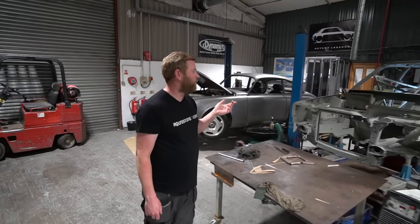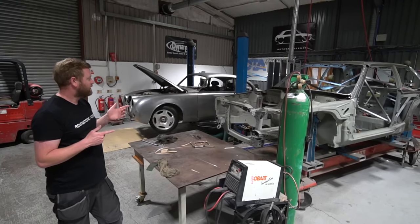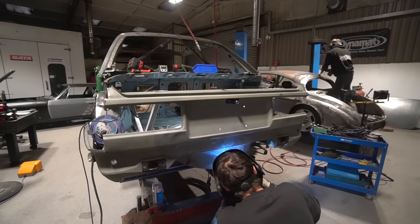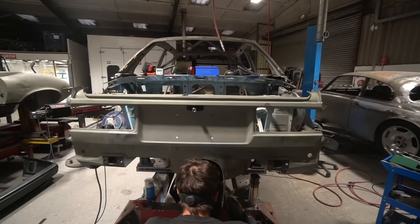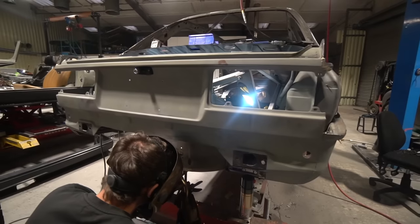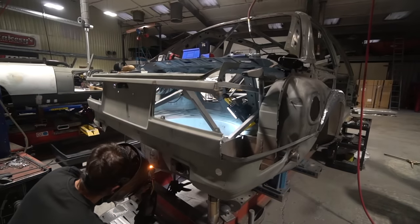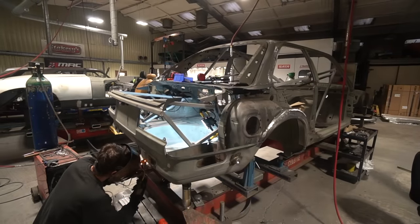Redux number four, couple of areas of attack. Scott's been on with the towing eye arrangement. So on these we changed, because we've got carbon fiber bodywork, but the carbon bumpers, in the process of redesigning them and tidying everything up, we got rid of the towing eye covers and redesigned the towing eye system to have screw-in towing eyes. And the front one kind of goes up under the bumper. The rear just sneaks under the bumper and goes into a heavily reinforced part of the spare wheel well. So Scott's been on with that.